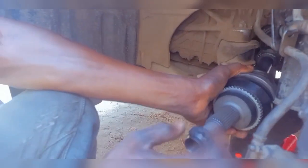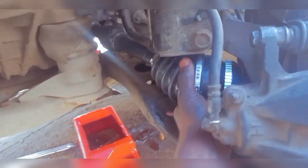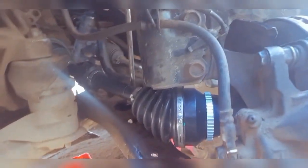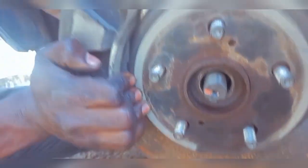You can have somebody have this one drilled back, then we'll have this nut loosened. So you have this one put in, and then the next thing that goes in should be the ball joint. So the ball joint goes in. Just make sure the shaft has gotten into the wheel hub here. You can see it's inside. Then you press down on this control arm that is under here. Press down on it a little bit.